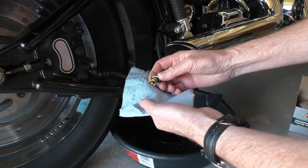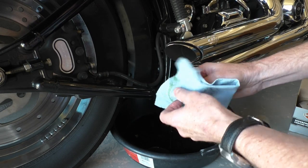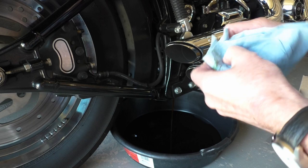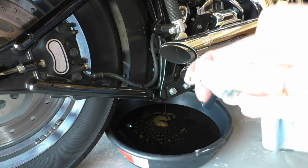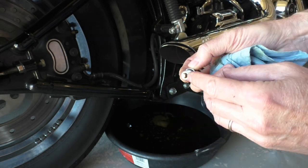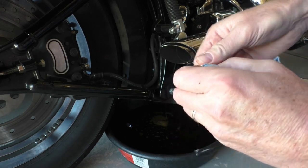And we start draining the oil. Then you want to inspect the plug — I don't see any metal on there, it's looking good. I'm going to replace that O-ring with a new one every time I change the oil. I'll clean that up and do that. I also check my threads to make sure everything's looking good. I'm going to slip my new O-ring on here. This is magnetic, by the way, and that's why I check to see if there's excessive metal. You're going to get a little bit of wear, but you don't want too much — that might indicate an issue that you'd want to have checked out.